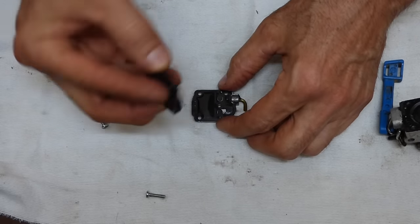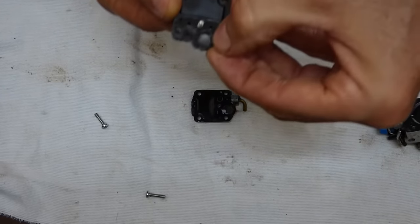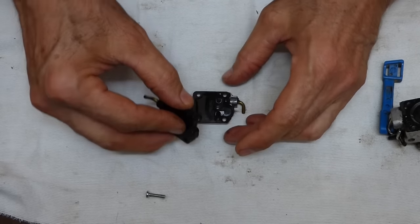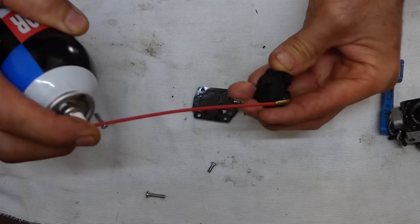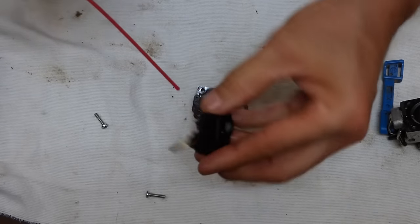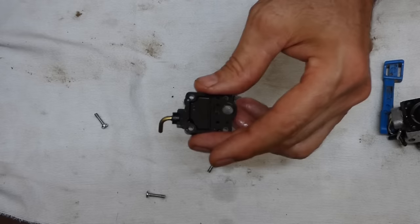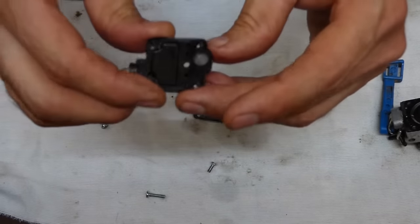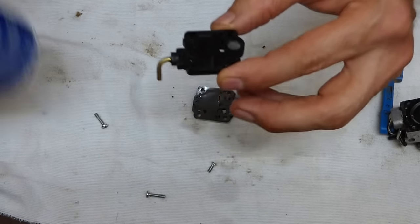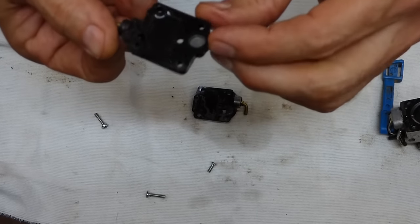There's the reed valves. It's a filter — it's a little dirty. Clean that out, clean this up, clean that screen. Sometimes that filter can just get gummed up with bad gasoline, and this carburetor cleaner will break that down. Looks good now. There's a little hole there and I can see straight through.